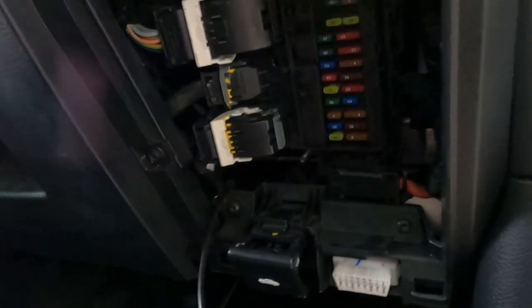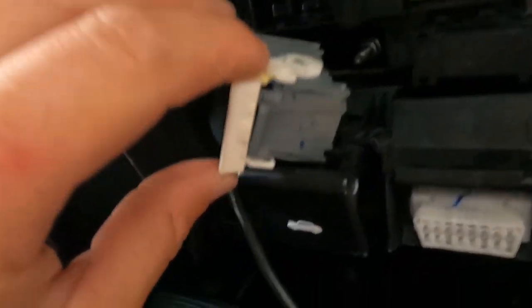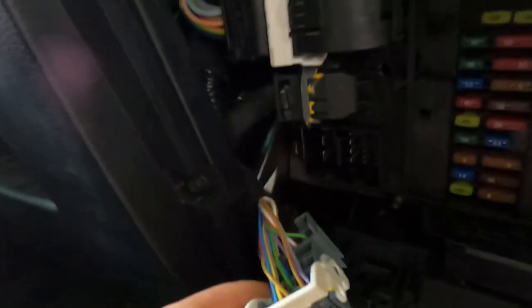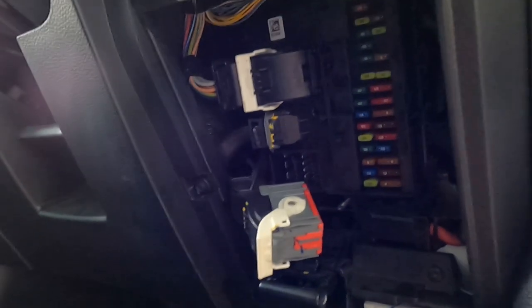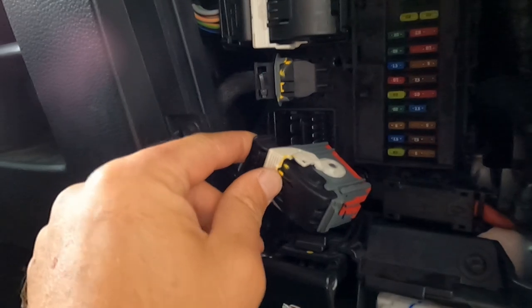This green wire comes around underneath, comes under the dash and up here. In the PX3 — mine's a 29E model — we're going into this connector here. Once you get it out and off, put a screwdriver in there and you should be able to push it to the point where it comes off. You can see all your wires. It goes above the purple one — just in that one there, just above the purple one. Take note of which side the red thing goes on; one's got a texta mark on it. Now it's ready to go back in.